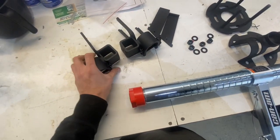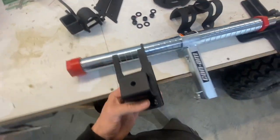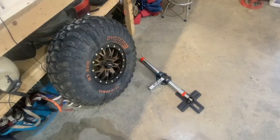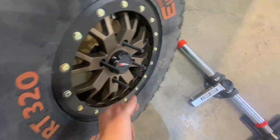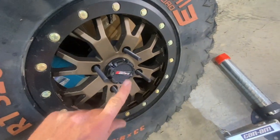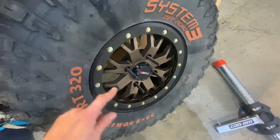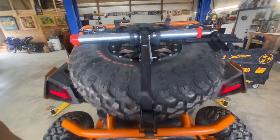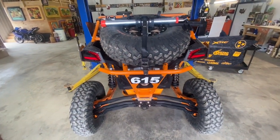These are some advised jack locations — I'll show you where they go. Basically they slide onto here, that pin goes to the hole to keep it from moving. You put the little plate through the back side of your spare wheel, set this little plate over the jack, and the holes line up with here. It squeezes against the tire, can't go nowhere, and you put it on your car and put your y-strap over to whatever and she's set to go. Here it is mounted on my spare on the back of my X3 XRC.